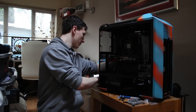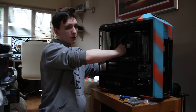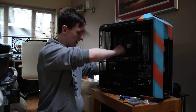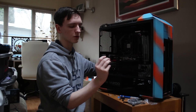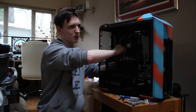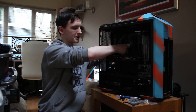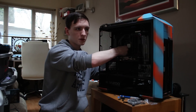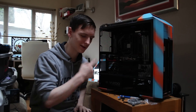You put the washer on, then they come with very small M3 nuts that go on top. Screw those all the way down so the screws are sticking up into the case, then put the metal washer on, put the cooler on, put the metal washer on, put the spring on, and then use the easier screws to hold it in place. I didn't actually realise this and was trying to screw on the CPU cooler from the wrong side — basically pretty terrible. As I said, this video was probably going to be more of a PSA than anything else, and I guess it's turned out to be one.